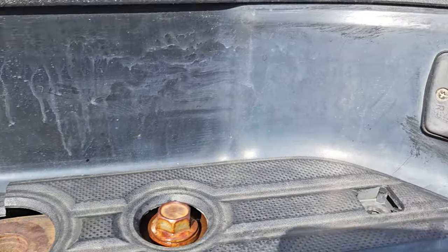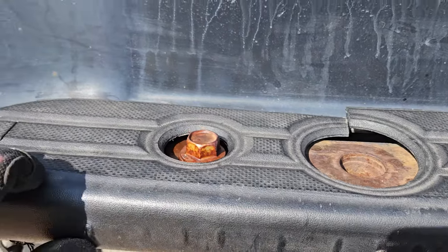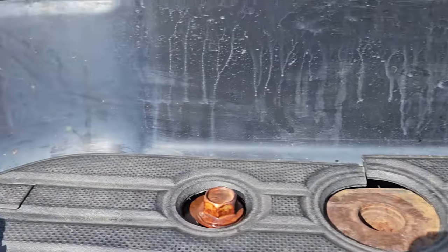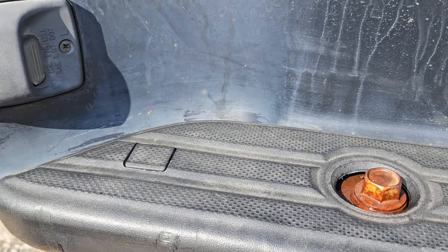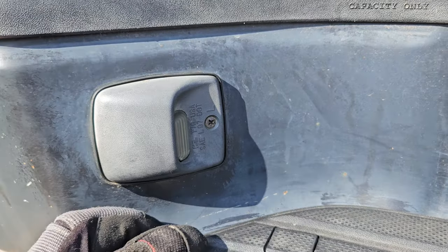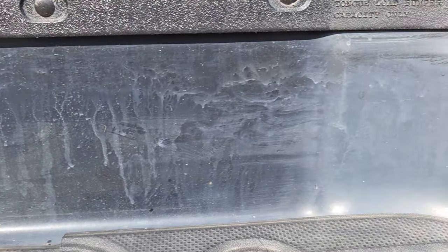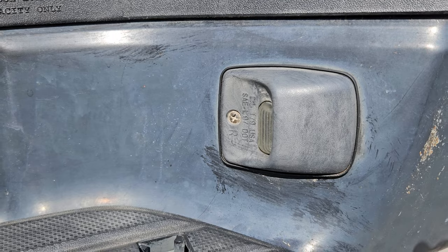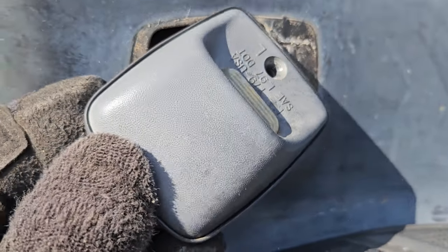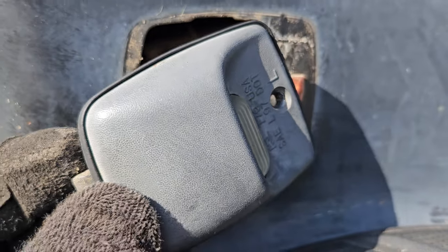First thing we're doing is taking off the lights for the license plate and taking off this plastic piece right here. You can see we've already got covers missing — there's supposed to be covers on each of these round holes, and there's supposed to be a cover here. We've only got one cover left. I'll pry that up. There's a plastic fastener here and two 10-millimeter bolts underneath. Just a Phillips screwdriver, then disconnect the electrical connection. Pop the screw off, take off the electrical connector, and you're good. A lot of folks like to use LEDs — you could replace the bulb or the housing.